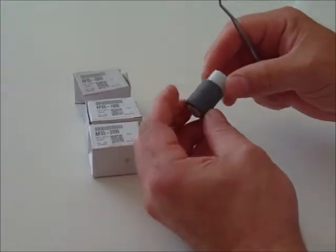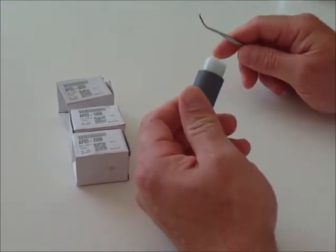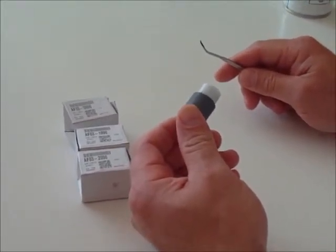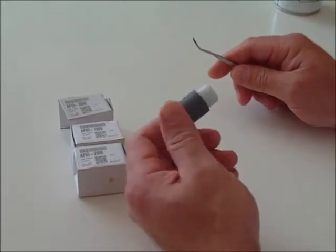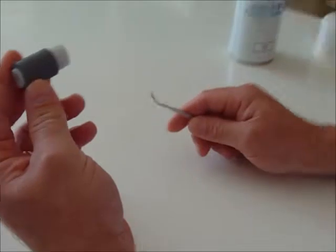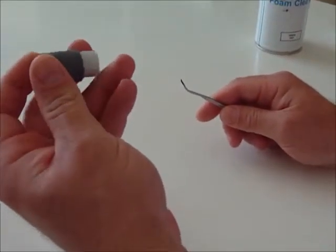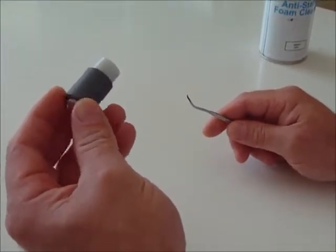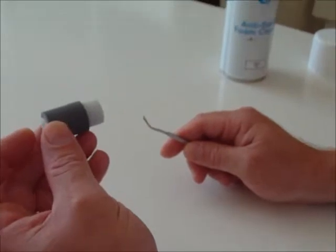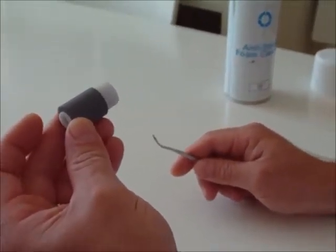Today we're going to be exploring how to fit Ricoh feed tires onto pretty much any KM machine, from Saturn based even back to some of the black and whites, as they all use the same feed tires. We're all familiar with these, the 2AR07220s, 7230s. They're okay tires, but they don't last very long. Most, if you're running heavy paper or even high quality paper, most you'll get out of them is 180, 200,000.